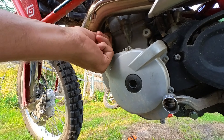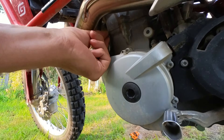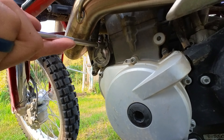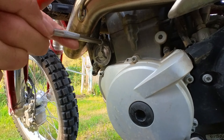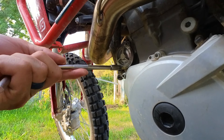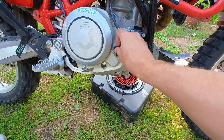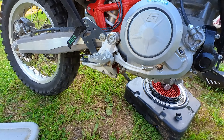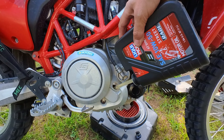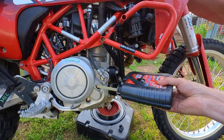Second screen's at the front. A really common sight with these filters on the first change is a whole bunch of colored flakes, and a lot of people get kind of freaked out by those wondering what's going on, what's wrong. Nothing's wrong — it is actually just the paint markers from when the engine is assembled. During first assembly, things are marked with hash lines to line things up, marking to show that it was done and torqued, double-checking everything. So those paint flecks often come off on the screens on that first change.